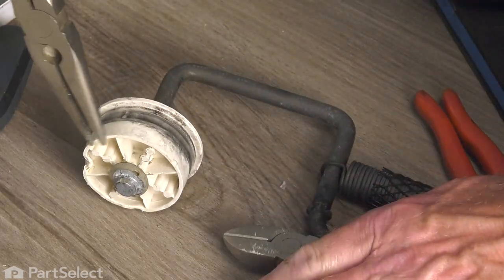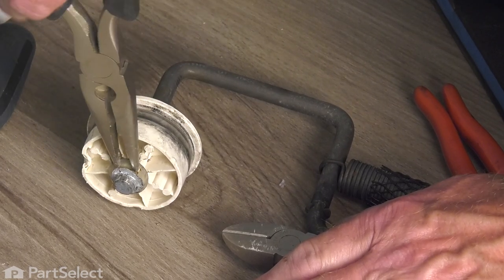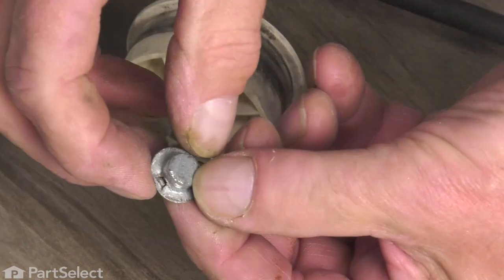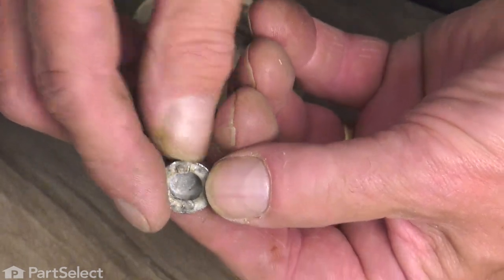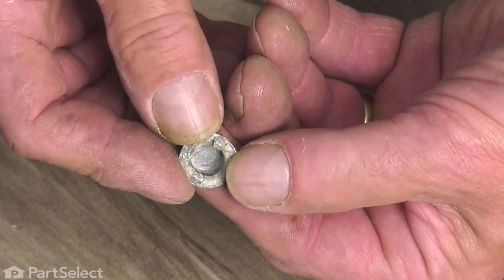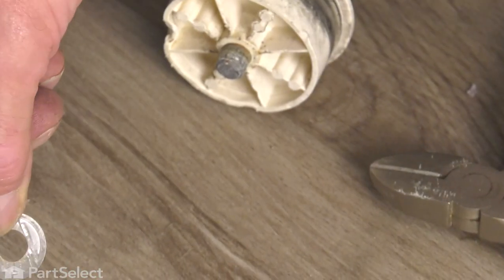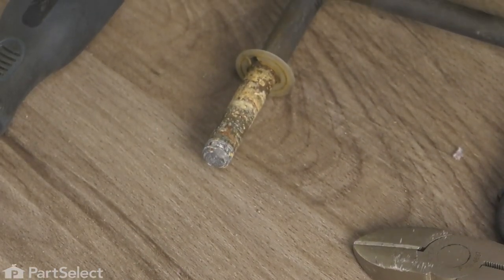Once you get that out far enough, you may be able to get a pair of needle nose pliers in behind it so that you can pry from two sides at the same time. If you're able to save that cap nut, we'll be able to reuse it. There are a couple of little sharp metal clips opposing each other — just make sure that those are not damaged beyond repair. If so, you'll want to order a new one of those. Make sure that we didn't damage the spacer washer, and then remove the old outer pulley.